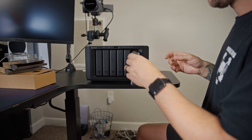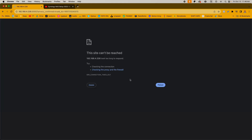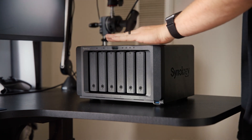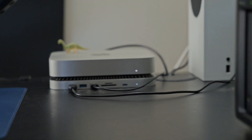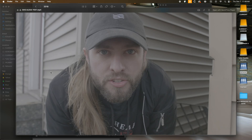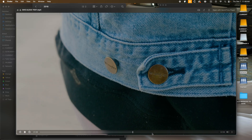With all hard drives in and two empty bays remaining, the big decision was where to put this thing. Originally I wanted the NAS away from my desk since it's network attached, but my internet is kind of dog crap. After experimenting with different spots, I decided to just put it directly on my desk. I found out I can plug an ethernet cable from the back of my NAS directly into the ethernet port on my Mac mini and they connect to each other without any internet router involved — actually really cool.